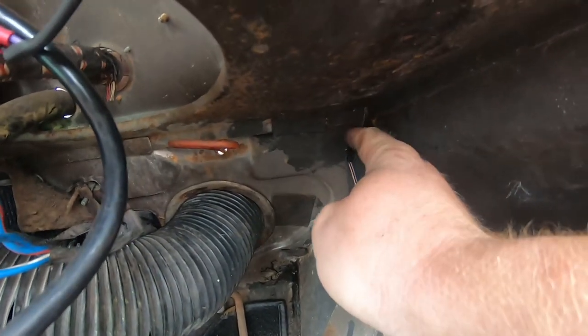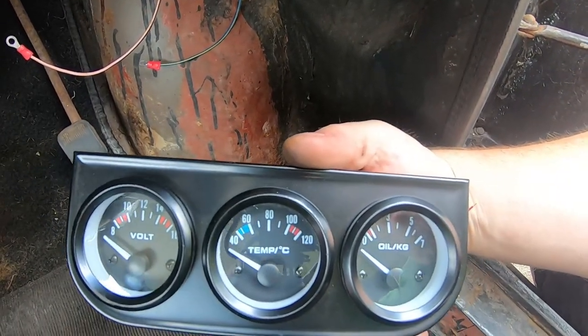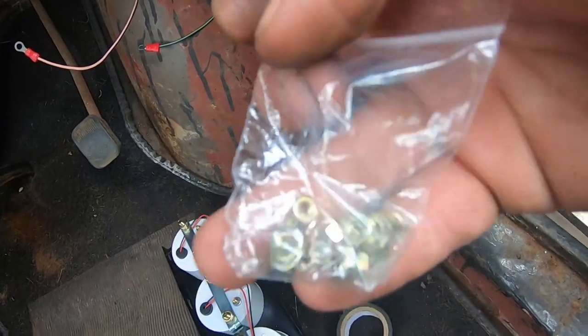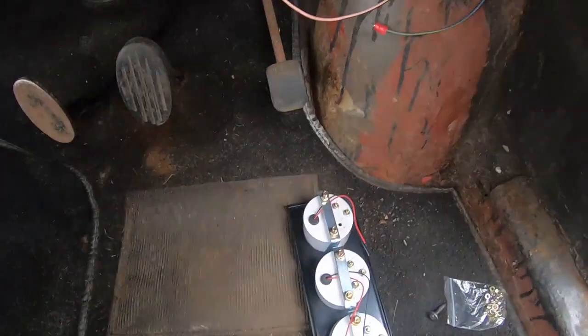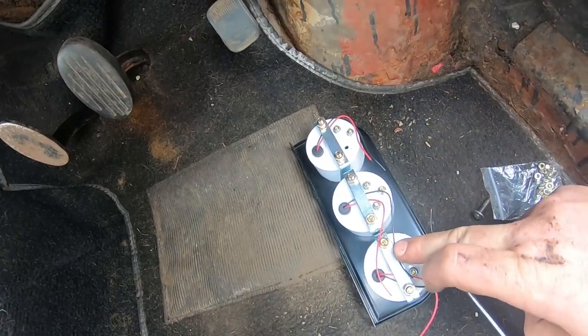Here we are. I've made a little grommet out of some insulation tape. Both wires have come through. I've got to hook up the blue one to the temperature and the pink one to the oil pressure. And in the little bag that came with the gauge kit, you have another little bag with some washers and some nuts. So don't undo the nuts that are on the back of here - I'm going to add new ones onto it. So I'm going to hook them on, then we're going to try and find an ignition feed from in here, and we'll be able to ground it out in here, and we should be able to get all the gauges working. What I'm thinking of doing is a little loop for the positive sides to save on loads of wires.